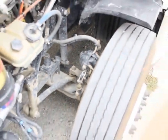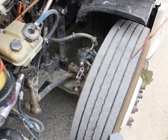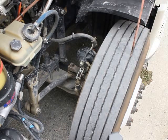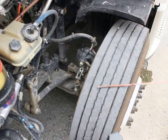My tire sidewalls have no abrasions, bruises, or cuts. The tread depth is at least 4/32 of an inch in all major grooves, and they have an even wear pattern.